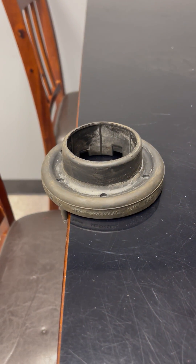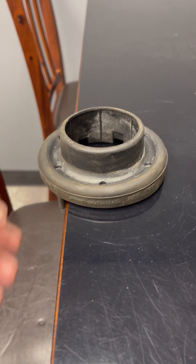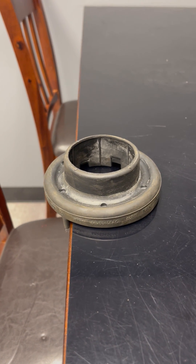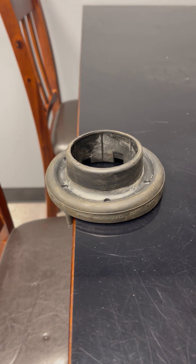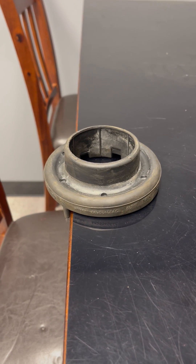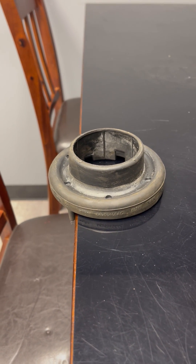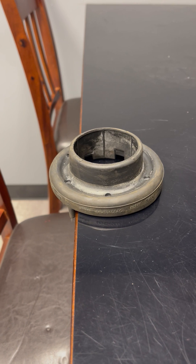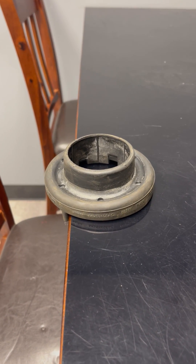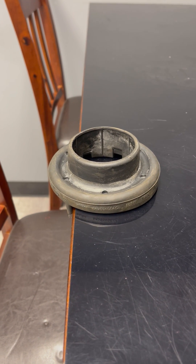The thickness of the top spring seat is now thicker on the outside than the inside. For whatever reason, on certain applications Jeep has completely redesigned this part, and what this can cause is your coils to bow towards the inside of the frame.